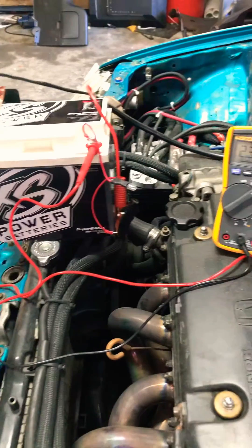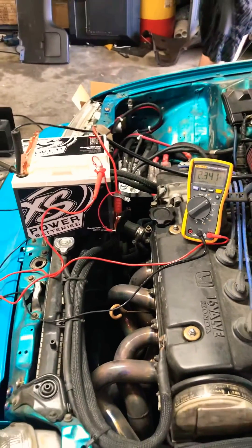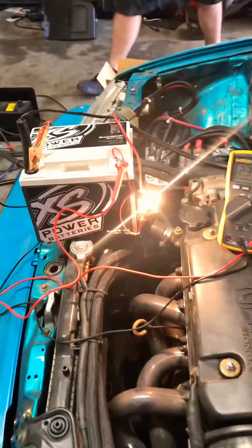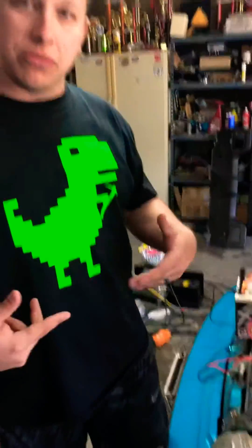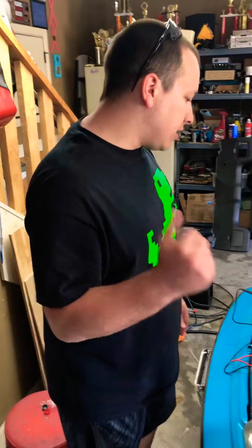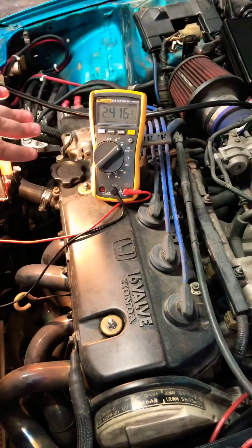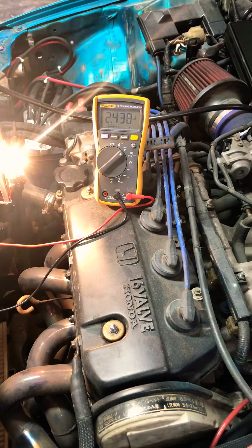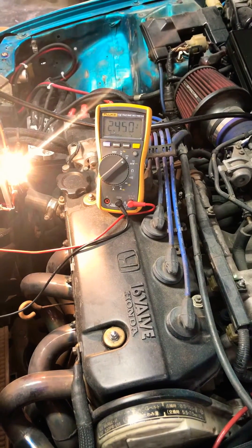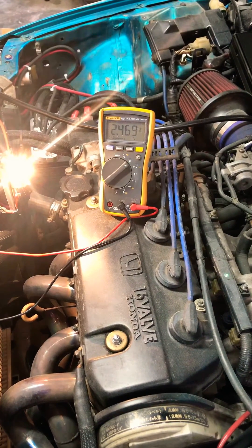So as you can see, I'm gonna start her now and give you an idea of what she's gonna do and what you can expect. What the light is doing is resisting it from charging too fast. So this may take a few minutes because it's a slow type of charge. As you can see, the light is resisting the battery from taking too much amperage. Now this one is a 14.2 volt cap max, so we're gonna charge her to about 13.7, 13.8. Let her sit for a minute and then get her close to doing the same thing.